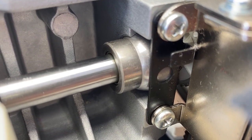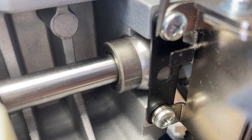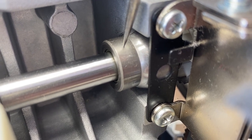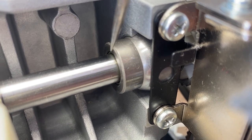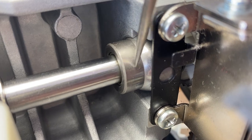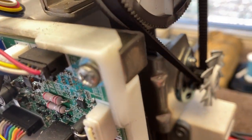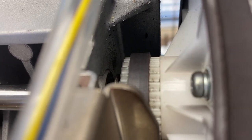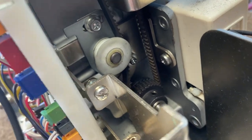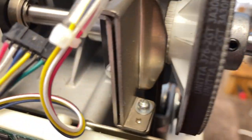These are very tightly fit together, and so as the shaft turns, it creates friction and heat from the friction. When it begins to heat, the lubricants impregnated into the porous metal lubricate the points in between. There's a lot of pressure because here's the motor belt, and over the top you'll see the timing belt, which is what connects the lower shaft with the upper shaft.